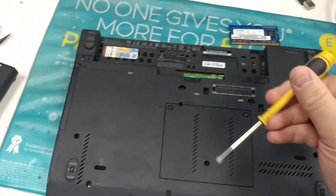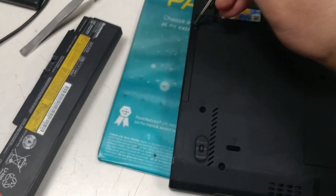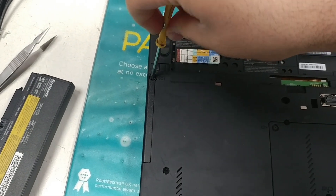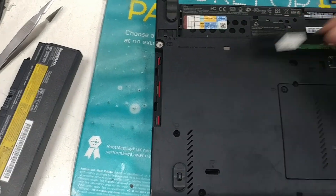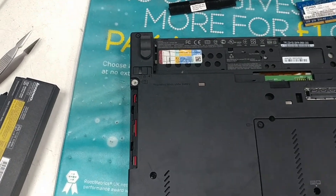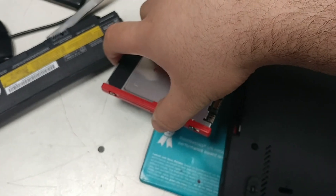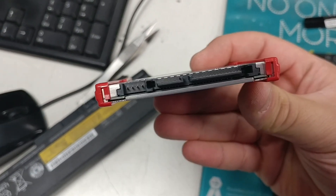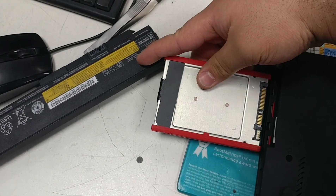What's quite good about the X230 is that the storage device is held in a very easy-to-access strip. You simply undo the screw on the guard and lift it out — put that to the side. Then you can simply slide in your storage device. Make sure the SATA connections are facing out toward you so you can see the gold strip.